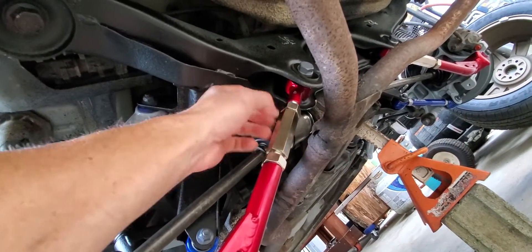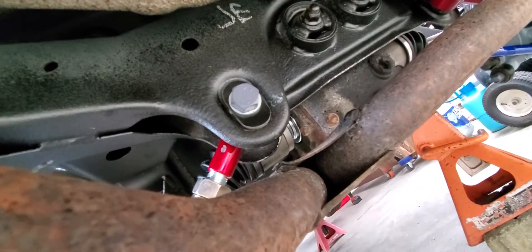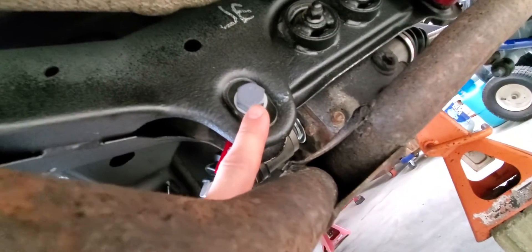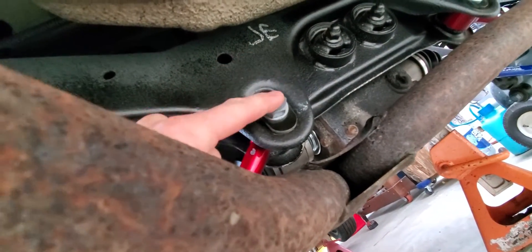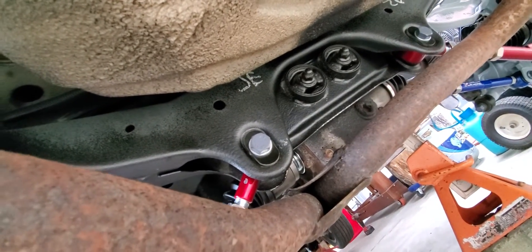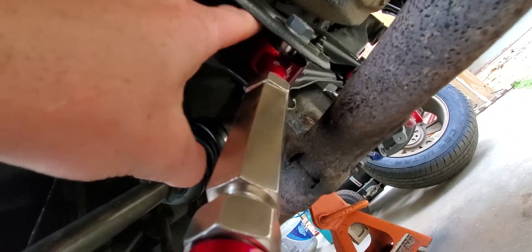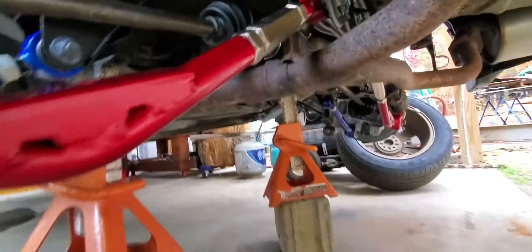For the mounts for the rear lateral links, I bought some metric bolts — a 12-millimeter bolt — and made some micarta bushings, because there's a horizontal slot where that bolt can ride in and out. Normally it uses a cam bolt, but that thing was so rusted I could not remove it, so I had to cut it out with a Sawzall from the inside, cutting the whole bushing out with the arm still stuck in it.